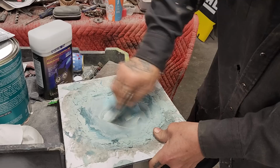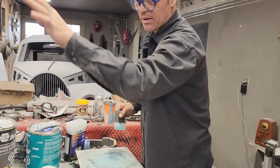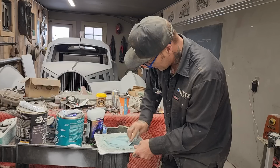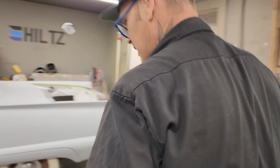So, count up the time. You have to figure it out in your own brain. I've already got it figured out. But count the time of glazing, putting, all the bodywork that was done on the car. You have to figure that out. When you get that glazing putty going, then you break through it, and then you get into your body fill, then you've got things that are different hardness and different textures. And then it gets wavy on you because you're using a really fine paper, because you want to prime it with no pinholes in it. I just find it's a daunting process, to glaze, putty, body fill. I find it very daunting.